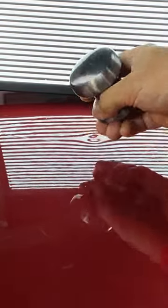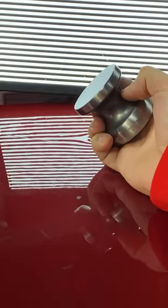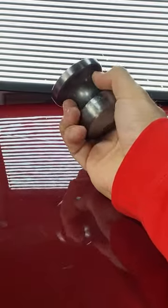All right. And we are going to be a little bit more aggressive so we can use the tap downs too. So again, using this, I'm pushing up and I'm working like this, okay? Or you can rock it back and forth. When you really want to get to the fine parts right here, I flip it around, right? I use this edge and I can work the little bits with the sharpness of that edge right there. Pretty cool. All right, hold on. Ready? Okay, so I'm pushing, and look at that. Already, look how fast that removes the dent. Super smooth. And then you just push harder.